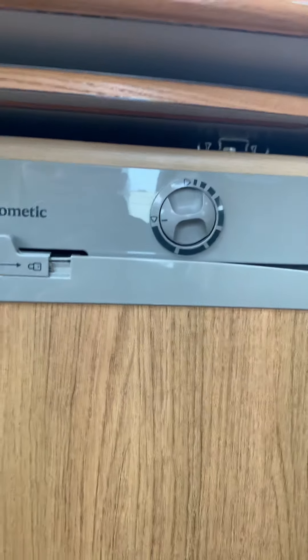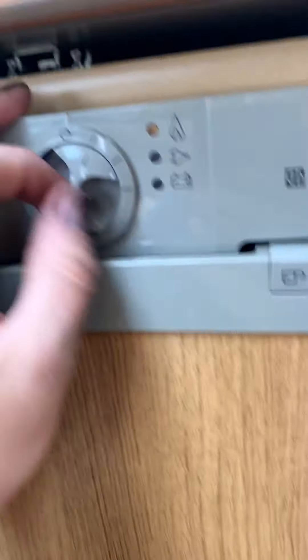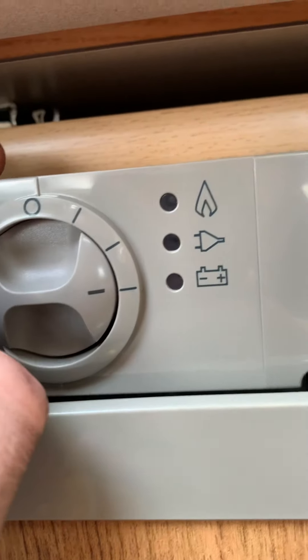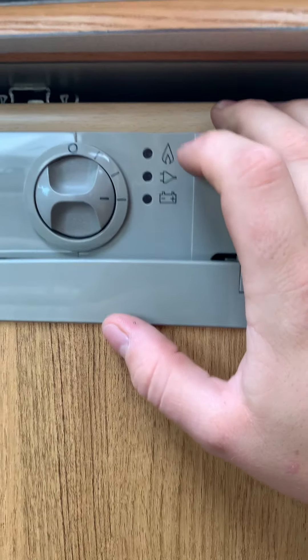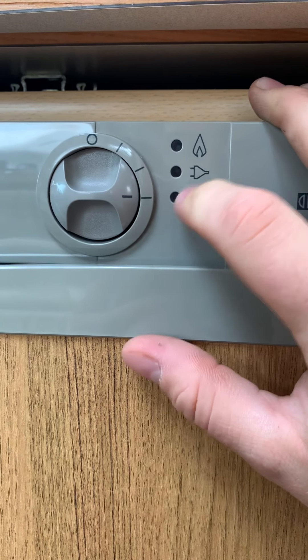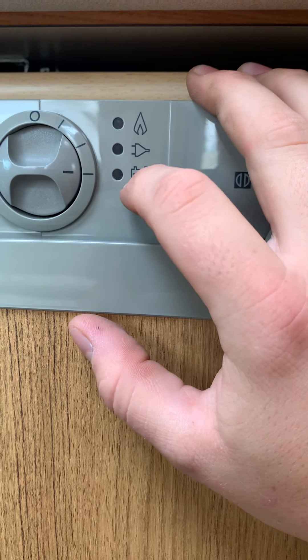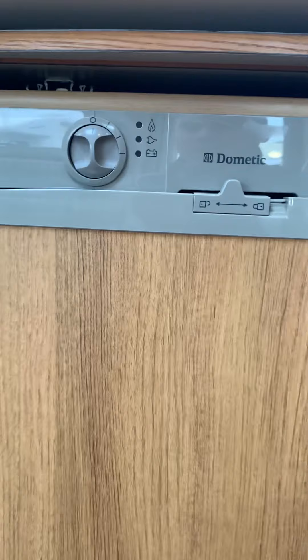Once it is lit, you can turn this all the way around, and then after about three or four hours with things inside it, it'll all be nice and cold. The other way of using it is the hookup — if you had a hookup cable plugged in, you'd get a little green light in there. Also when your engine's running, put it down to the very bottom one and you get a little green light in there. Basically, get the fridge cold first — I'd advise you to do it the night before. Either via the gas or the hookup. Then use this 12 volt one just for when your engine's running. When you get to where you're going, everything will still be cold inside the fridge, but then you need to switch it back over to one of these two when you get there. Obviously you cannot leave it on gas when you're driving — same with any gas appliance, you can't leave anything on gas when driving because it's really dangerous, and also because you have to turn your gas off before you start driving anyway.